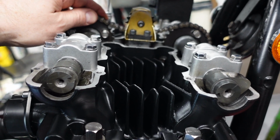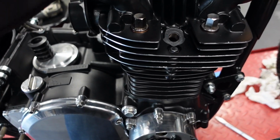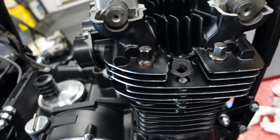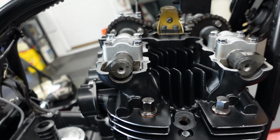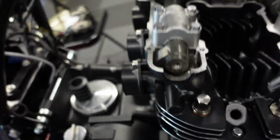And then when I tried to move the chain, I tried to do it by turning the engine, and that screwed up the timing of this one. And at some point, I couldn't turn the engine because it was interfering with the valves. So I got it, but I played with it, and it took hours, and I've got it into time now. So, that being said, I am going to go for a ride. And this one, maybe I'll start it up here.